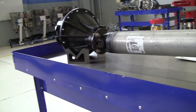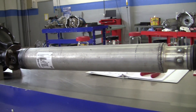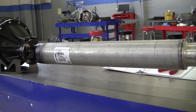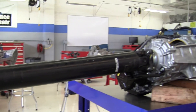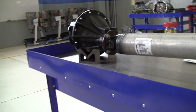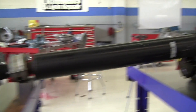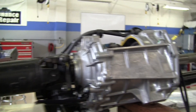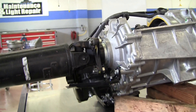As long as all of those are within plus or minus 3 degrees, technically it's within specification. But this is a beautiful drive shaft as far as being set up properly, because all of these are equal within half a degree, which is quite a challenge. Try that on any other propeller shaft and I think you'll be surprised at how hard it is to get that lined up. This is definitely a well-built propeller shaft.